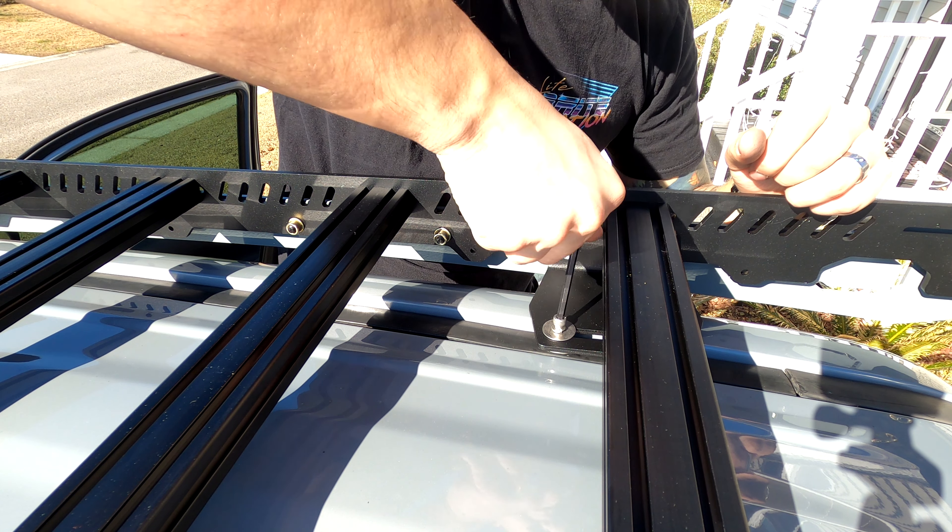It's all tightened down and up here super solid. The connector bolts on the side are 170 inch-pounds — I realized I don't really care to torque them beyond my hand tight. I also didn't add any thread locker as you saw. You probably want to add thread locker on some of these bolts — for your Armor Tech or your rails — just to make sure they don't come unscrewed. When you have two different types of metal like stainless steel bolts and aluminum bars, they like to back out of each other. The thread locker will prevent that — eventually I'll go through and add it, but not today.